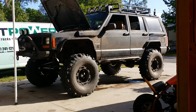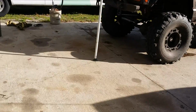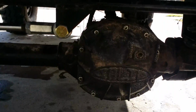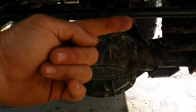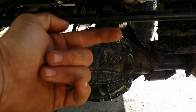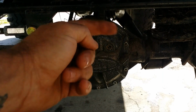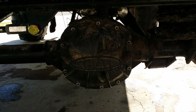But anyway, one guy was concerned about the front pinion backing up and going forward like that. And see, he knows something that I had to figure out the hard way. When that Dana 30, a high pinion 30, a high pinion 44, any high pinion, your pinion gear is so high up in the axle that your oil level is not lubricating it in reverse when you're backing up like that, because these are reverse rotation. So when you're traveling forward, it's high speed, it's slinging oil up into that pinion, right? When you're backing up, it's going down, it's slinging it into the cover. So when you're going in reverse, you don't have any oil on your pinion. And when you go back forward, it will. And then when you back up, it don't, okay? And it will burn the bearings up because of that, especially if you're beating on it like I was.